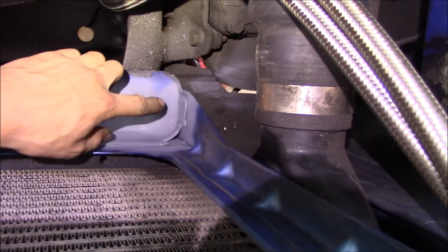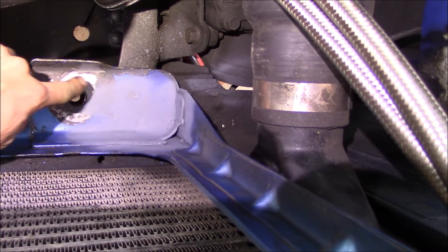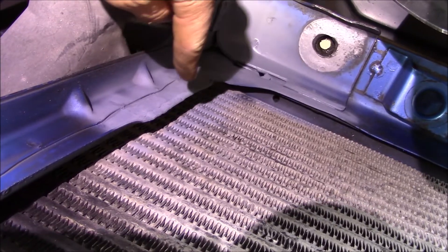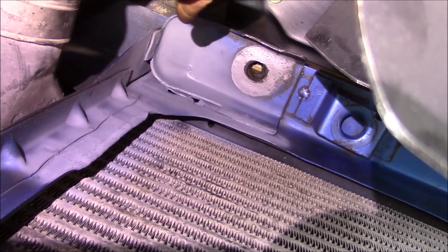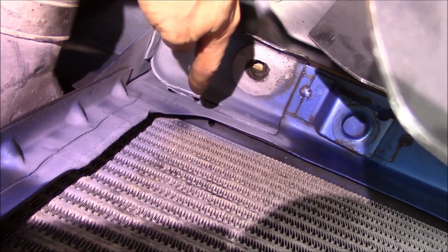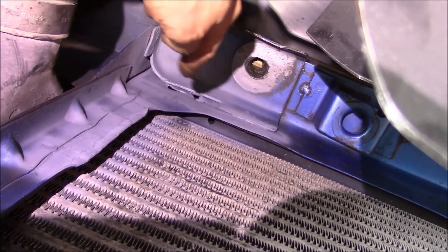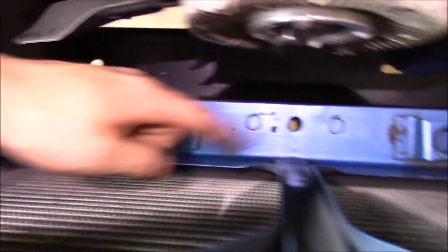Here's what I had to do to get it to fit. I had to cut this corner so that it's about as level as the other side, so now there's enough room for the tank. I had to bend this a little bit and do some peening in this area, and I had to fold this area over. I had to cut the same corner out of this side so that it's level over here, and then cut a chunk out here. I didn't realize that this was such thin metal, so I accidentally tore it a little bit going through the spot welds. But I'm going to cover up these rough edges with some foam tape so that the tank isn't chafing on all the steel down here.